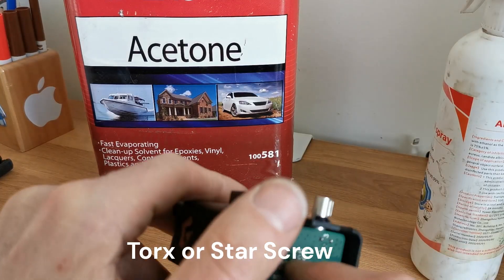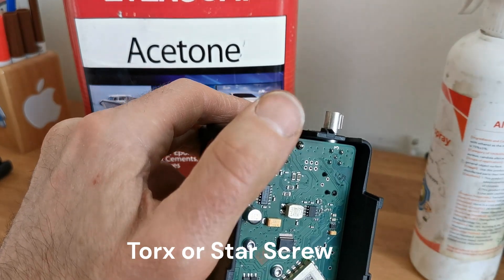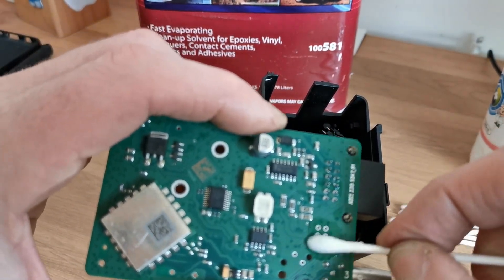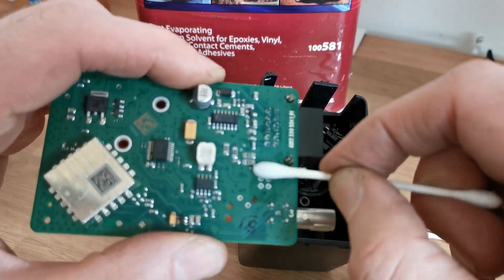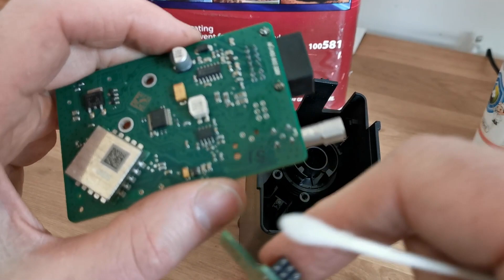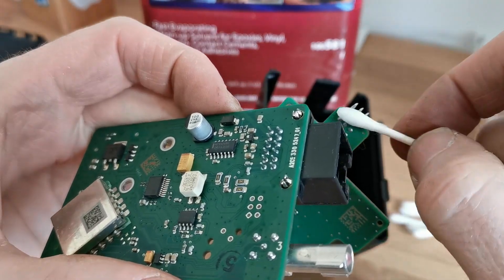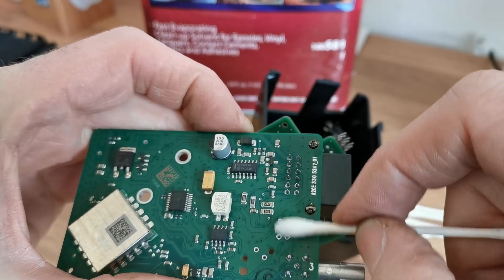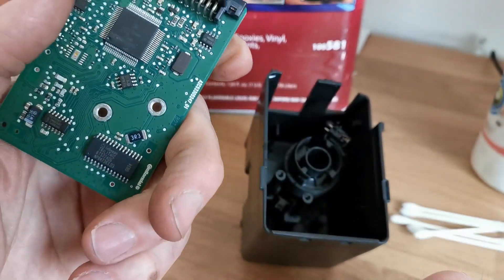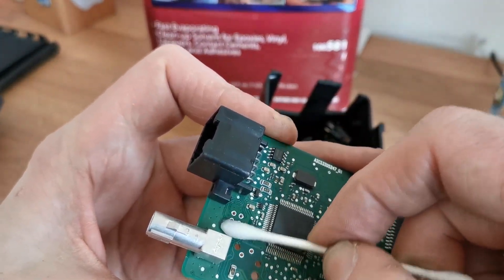There are six little contacts poking through right there. The six little pins go in onto the circuit board from the other circuit board that comes from the key chamber. So these top six pins need to be cleaned, and this one probably needs to be cleaned too, if that was in fact the problem — because there's no solder on those, it's just a press fit.